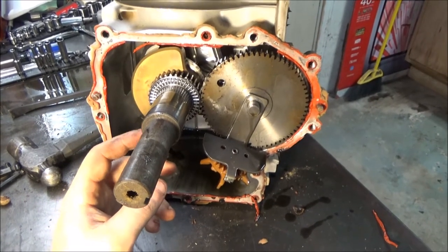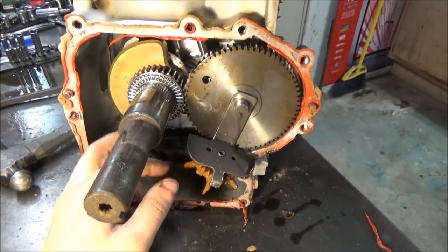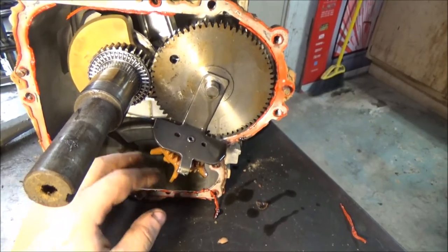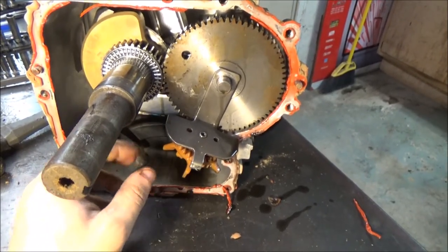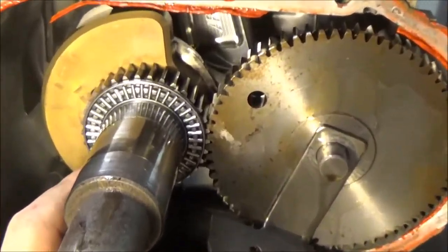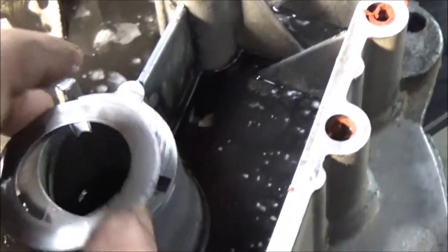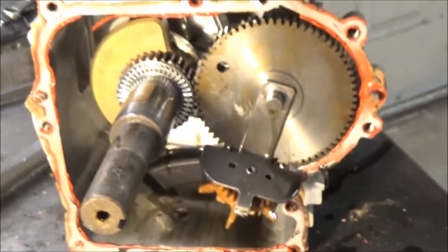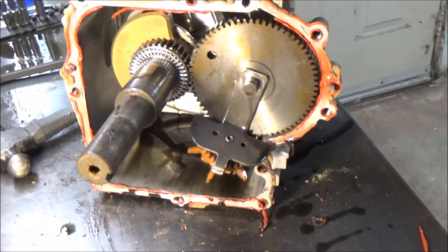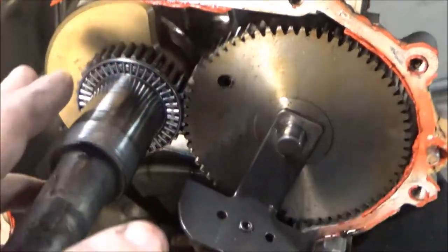And we're inside. This is what it looks like inside of a Briggs 28. Again, this is a somewhat race motor. It's got the brass counterweights instead of the big heavy cast iron weights it came with. They came with weights that moved on an eccentric. That's gone. Also, I got a little needle roller bearing here. That's an addition. Here's the other side of it. That's just to alleviate the weight from sitting on the bottom of the pan. And sometimes they wanted to eat into the brass counterweight on top as well.